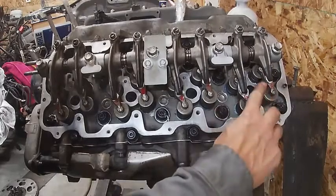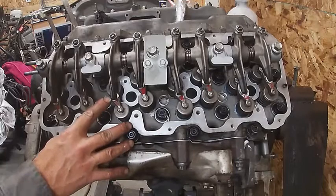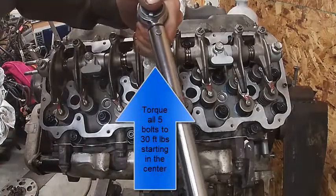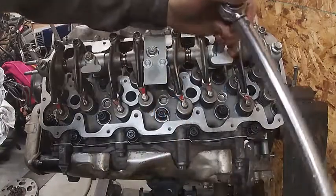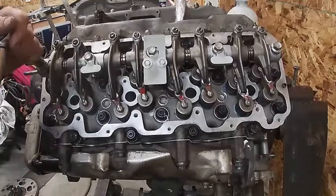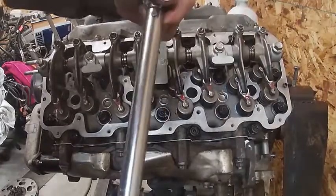Before I'm done, I'm going to make sure we're still on the valves — make sure we're on the valves here and here. We're going to go ahead and torque those to 30 foot-pounds, start at the center. Running them down does that. Come across and recheck.